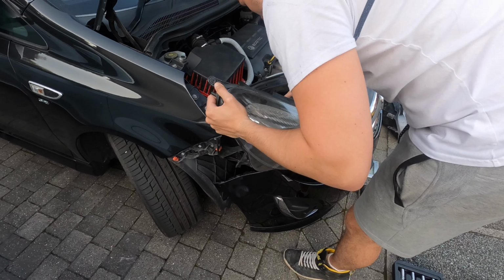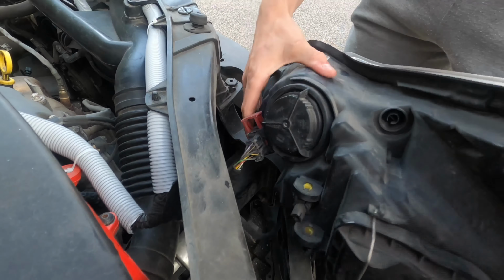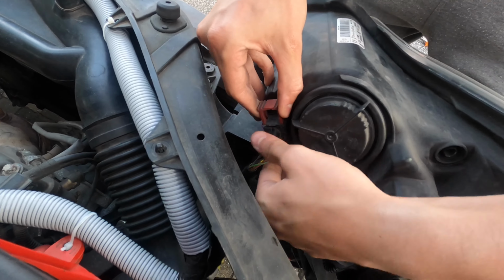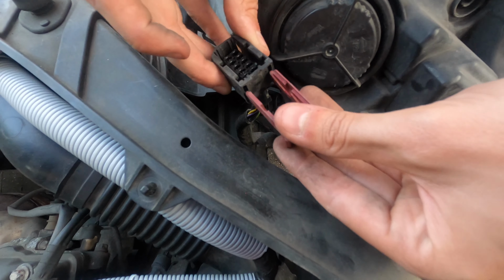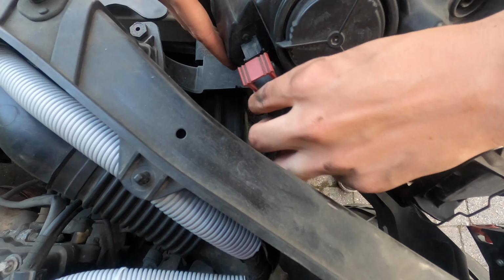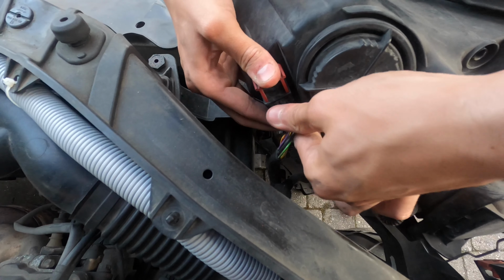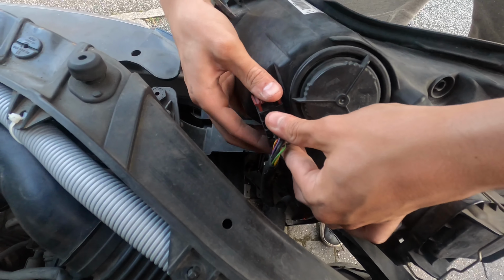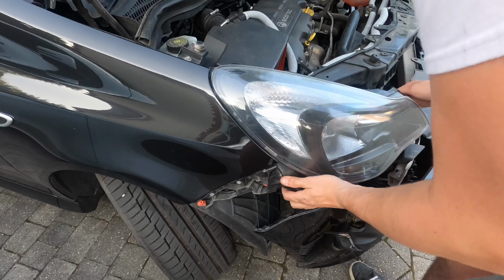Now that you've completed whatever you were doing, so headlight bulbs or tint, now you can reinstall your headlights. The red clips can be really fiddly, so don't lose faith. So that's got to be lined up, the little groove there and the little groove there. They have to line up there, like that. And this goes on, like that. You push it in. Come on, please, baby. Ta-da. And now you're ready to start reinstalling.